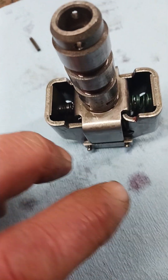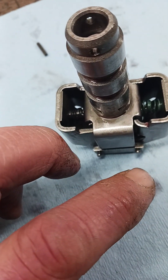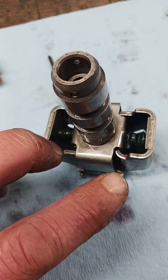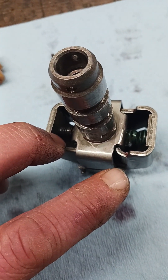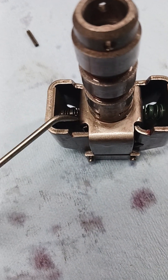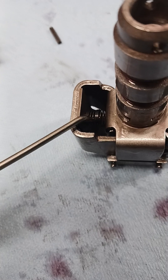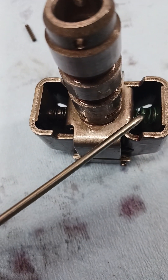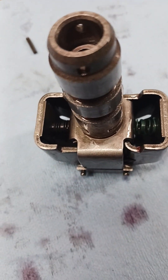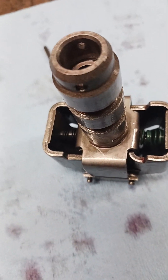I removed this one for two reasons. This is a fresh transmission — I drove it a couple days ago test driving it — and I realized I needed to change the shift points a little bit, so I've got to tune the governor a little bit. I've got a spring here and a spring here, so I have to change those.